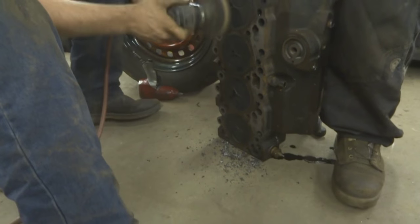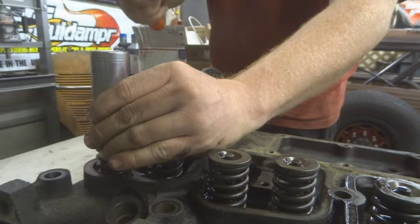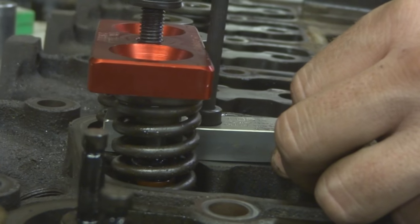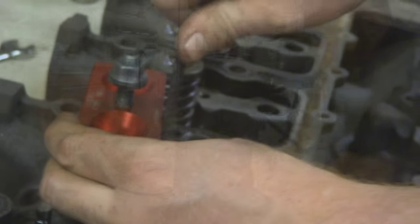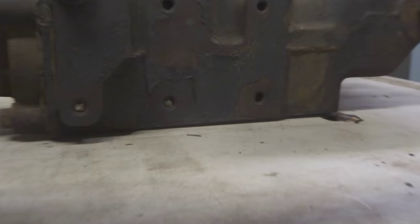But when we did have access to a tech angle wrench at the other shop, when you reach your angle, it tells you the foot pounds that it takes to reach that angle. And it was 150 foot pounds plus or minus two. Okay. So that's why we just set it to 150. And like I say, if it clicks before we get to 90 degrees, we just leave it be. And if it makes it to what we see as 90 degrees before it clicks, then we'll just leave it be. Yeah, it's lifting the head up right there.